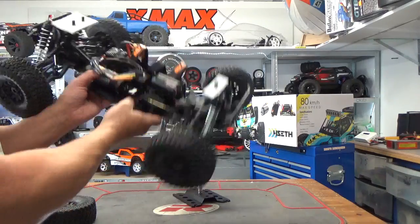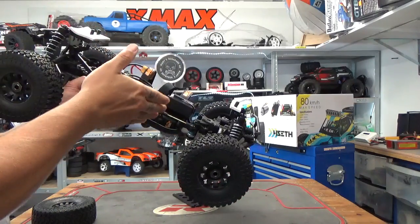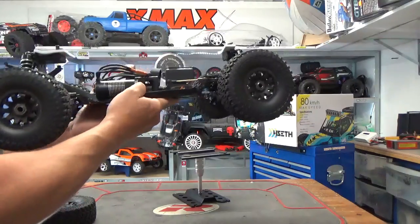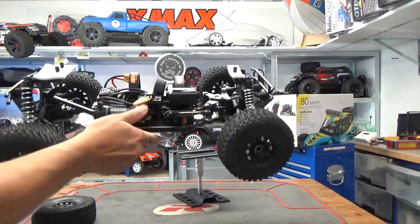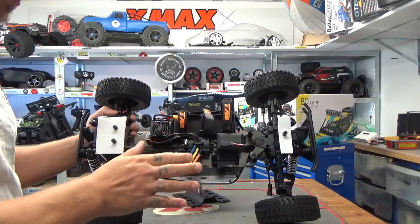We also have here this bad servo horn, and as I said just before, with this heavier weight, this clearly will be an issue in this car. So I have a 74mm motor, as I said, not the stock 2500 kV. For the moment I keep the stock ESC. I will drive this car on 4S, it's enough for me.